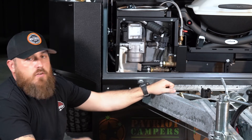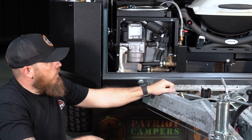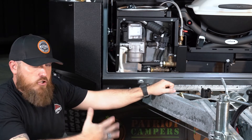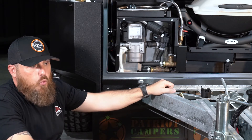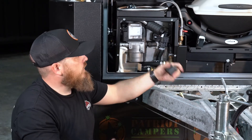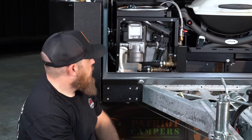If it's still smoking or still not turning on, run through the procedure again. If you've done it a good number of times and you're still not getting the result you want, it's probably time to try a servicing dealer. That covers the first part — cleaning up carbon to address smoking, a no-start or shutdown issue, or as regular preventative maintenance, especially after being at high altitude. Once you're happy with the results, replace the filter cap — it just snaps back on — put your front cover back on and you'll be in business.